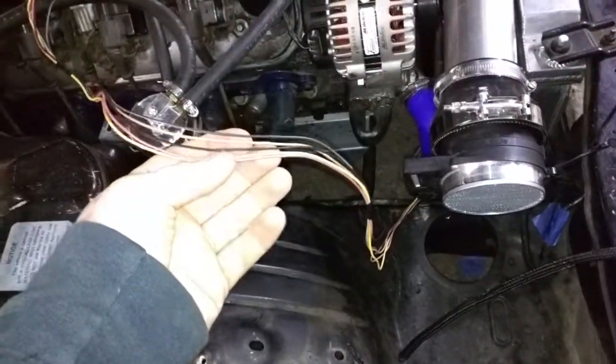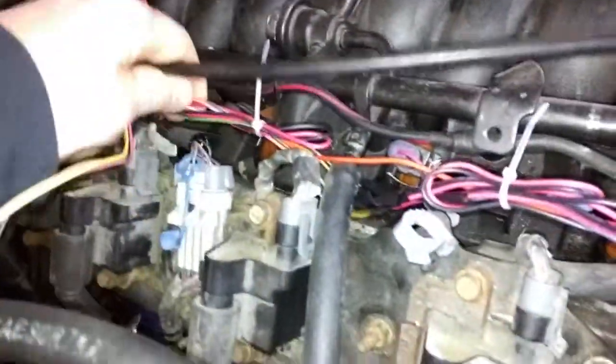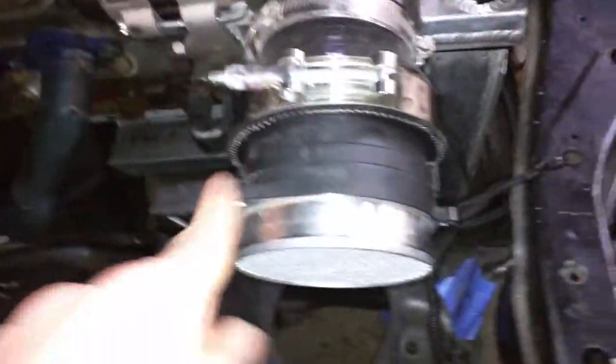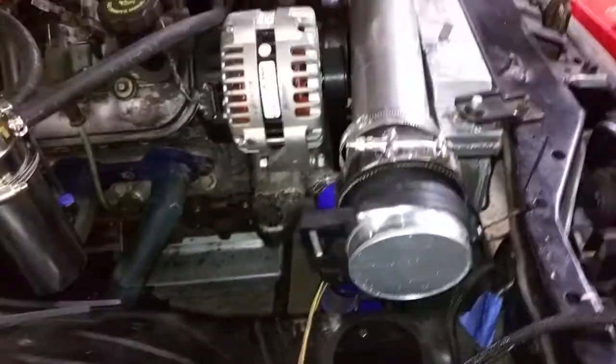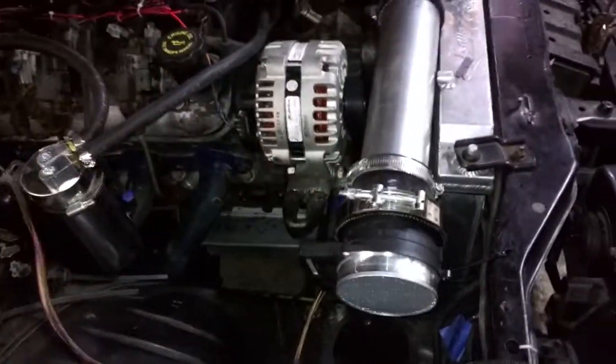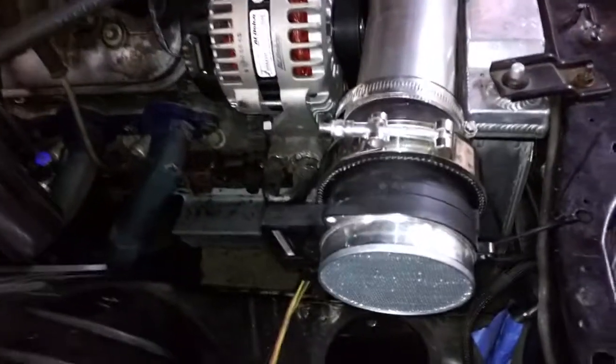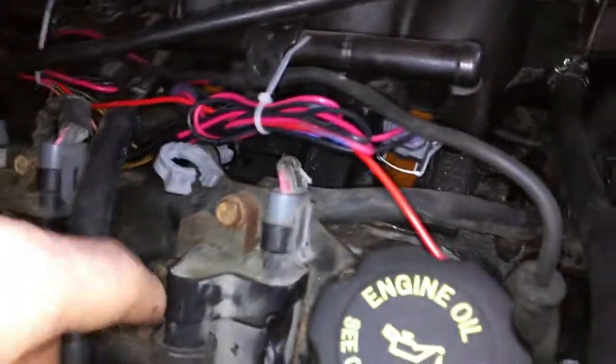So there's actually these 5 wires I had in this part, the wiring harness for the engine, and this tan one's actually a 5-volt signal that goes to the MAF sensor, which actually has an intake air temp built into it, so it reads the mass of the air and then also the temperature. So one thing I'm thinking it could have been is when you run all these wires, because it's only 5 volt, next to items like the injectors and the coil pack, you run into problems where the signal gets interrupted from all the other wires that are pulling a lot of current.